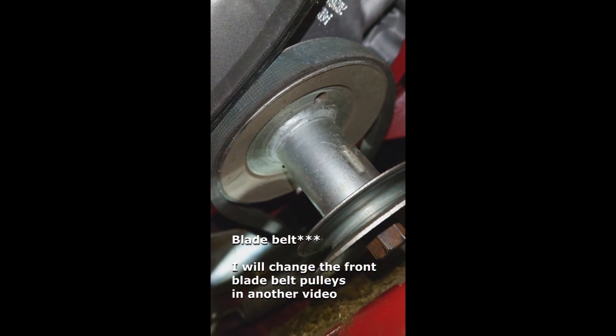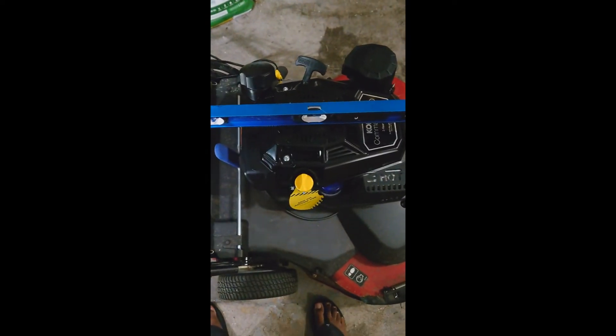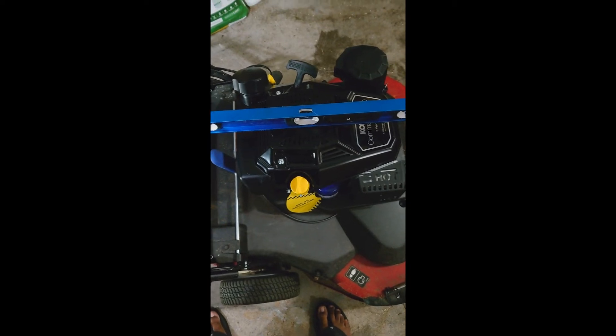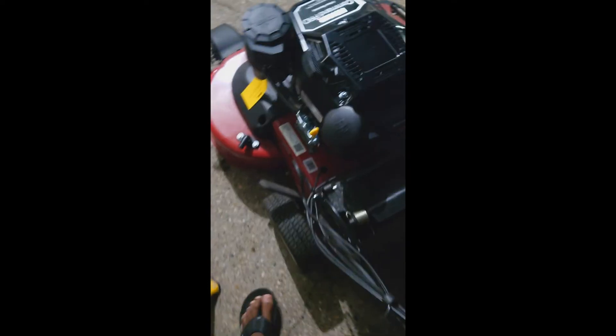Both bolts are tight. The blade pulley is already on — I'm going to be swapping the pulleys out too. I'm using Kohler Pro 300-hour extended life synthetic engine oil, 10W-50, as recommended in the owner's manual. I got it at Tractor Supply. After about 14 fluid ounces I still need to hook up the throttle and mount it — I'll make another video on that.